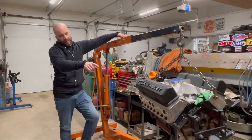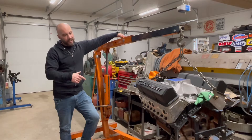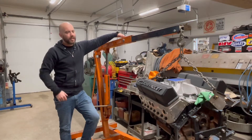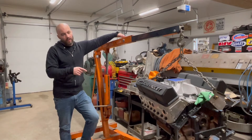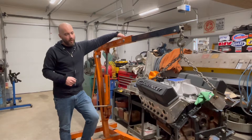In this video, I do want to show you how to install the flywheel and why that's important. But this video is going to be kind of just a fun thing to watch in time lapse of us getting it on the run stand. Before we do that, we are going to show you how to install a flex plate flywheel on this. We are actually using an Eagle one that came with the rotating assembly — it's already been balanced with it — and of course we're going to use ARP hardware.